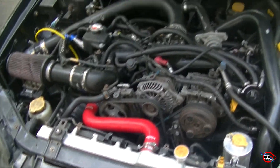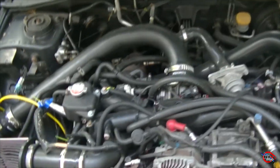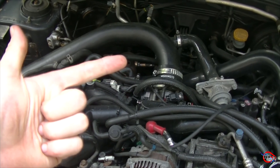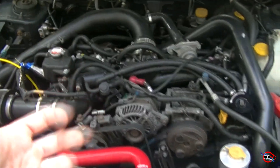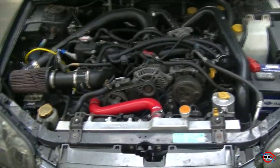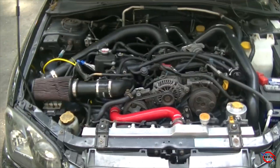The engine's been in there for close to a year now, and I just had the old short block lying around. I finally took it apart like a week ago. So it's better pistons, a good tune, speed density, and avoid situations where the engine is knocking. That's obvious, but really any situation you're boosting — if it's really hot out, if you're heat soaking your intercooler in traffic — just be careful, don't boost the car at low RPM, and have fun with it.